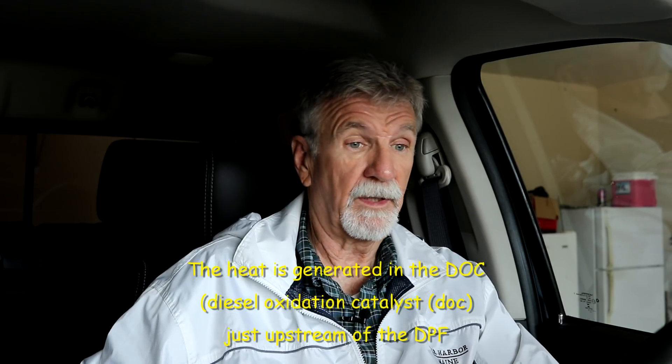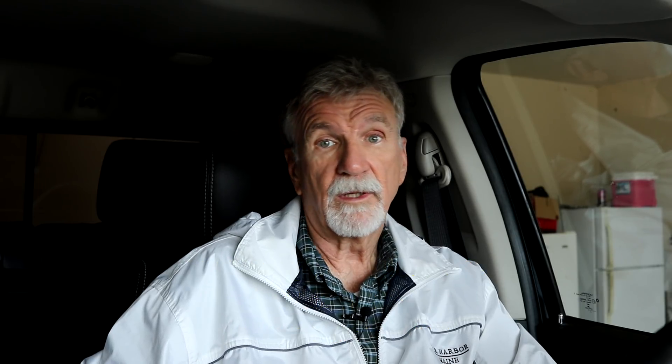You really don't want a fire in your DPF filter — that would ruin it and could blow the truck up. That's actually one of the causes of DPF filter failure: an actual fire inside the filter. Normal regeneration will go up to about 1100 degrees Fahrenheit at its peak, and it'll burn for about 20 minutes, usually between 950 and 1100 degrees. When it peaks out at 1100, I know it's just about finished. Let's crawl up on the truck and take a look at those lines.